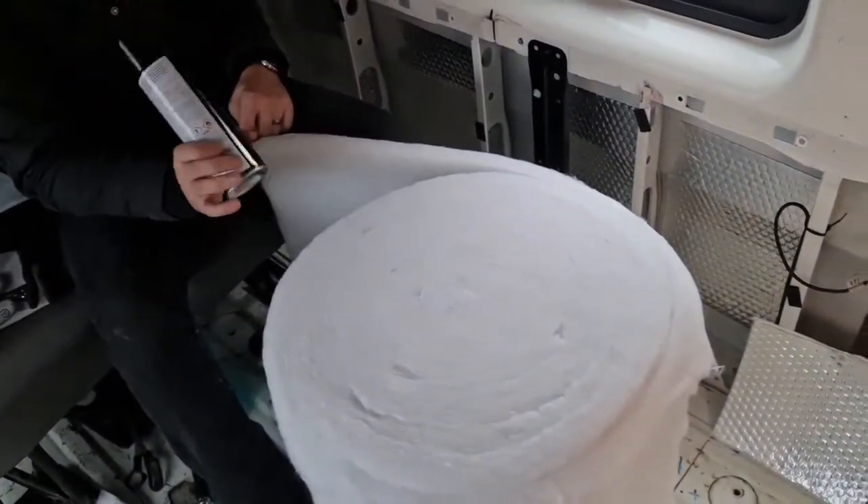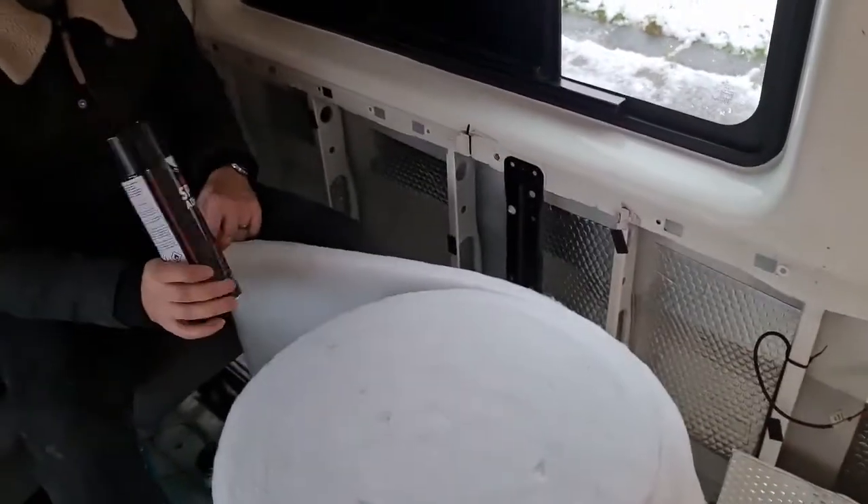One roll at a time — we're going to spray, and again because the van is so cold we're going to have to heat up the panels. The spray adhesive needs 15 degrees minimum, so we've definitely got to heat everything up. One of us can be heating while the other one's trimming a piece to size — teamwork, dream work. Right, let's get on with the insulation!